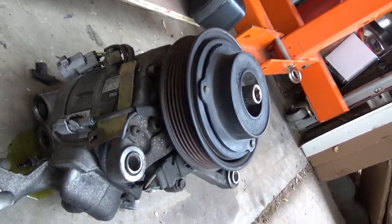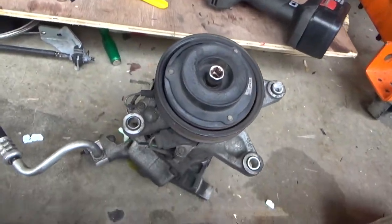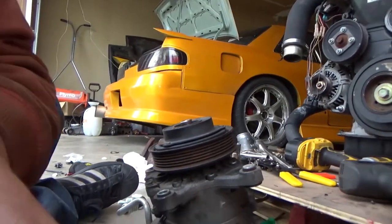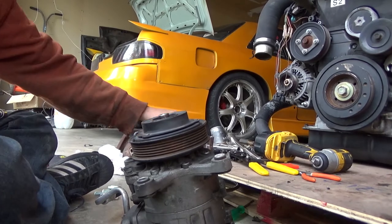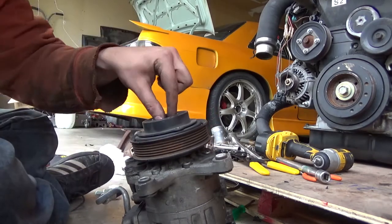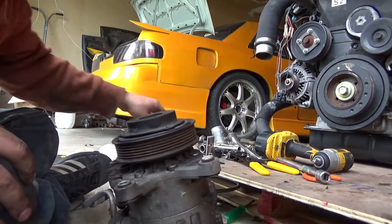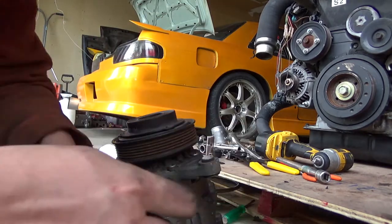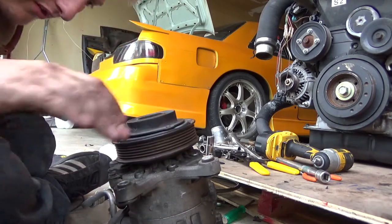Here's a video for those of you that would like to figure out how to gut the AC compressor and reuse it. Basically this is a 10mm bolt and this is a magnetic clutch for it. So what you want to do is take this bolt out, then you have to get an Allen wrench — I just have my generic metric Allens. You may have to use a 3-prong puller; I didn't have to on my last one but this one I might.